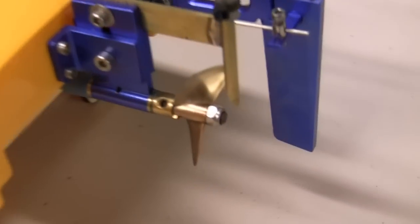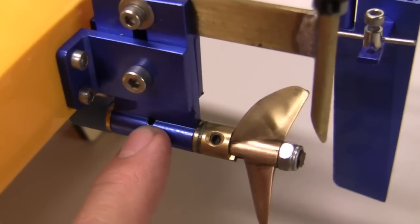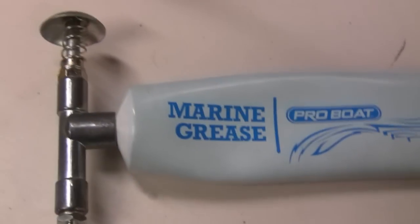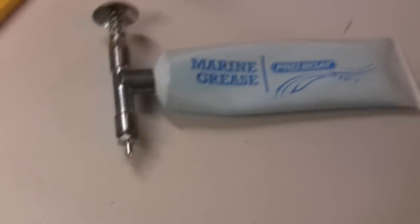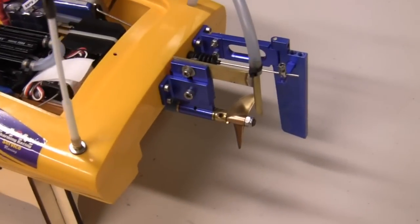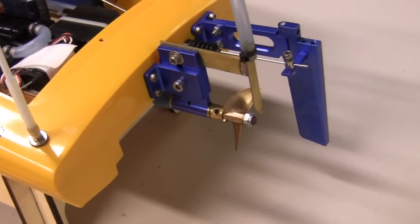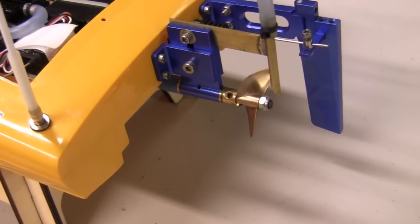Another mod that I did was I drilled a small hole in the strut to allow me to use one of those Pro Boat grease guns to grease the bushings without having to take the strut apart. You can get these at any local hobby shop — Pro Boat makes it. It's a little grease gun that you just screw the tube of grease onto, put the tip in the drilled hole, and squeeze the button to lubricate the bushings really well. So I usually don't have to take my prop shaft out except maybe once every five or six runs just to check. Usually after every run I just squirt some grease into that hole — it works great.